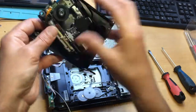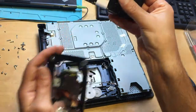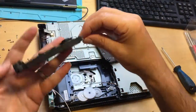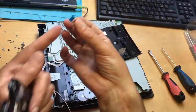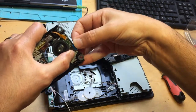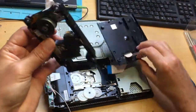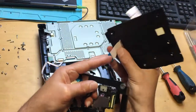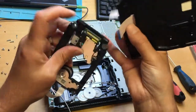So with the laser deck, get your replacement. First we need to take this one off — so you unclip the laser here. You've now got that laser off. When you buy your new laser you'll probably just get it like this with the deck. So you will need to take the old ribbon cable off and put the ribbon cable back into the top of there. This is your new laser — you need to put this connector cable back into the laser. It's a bit tricky if you've never done it before.